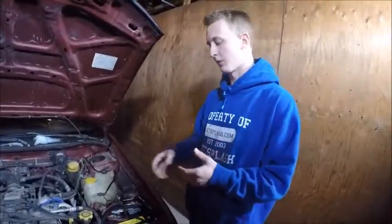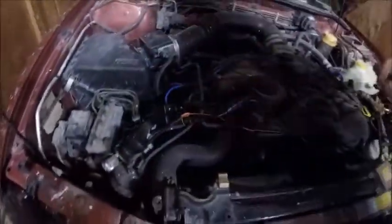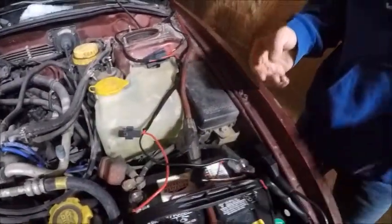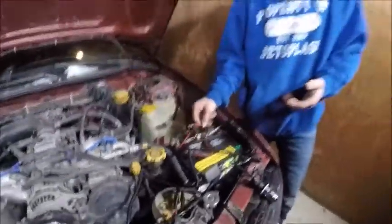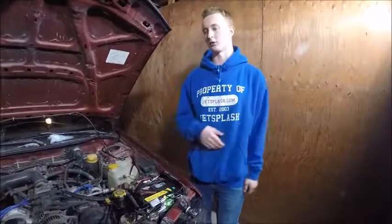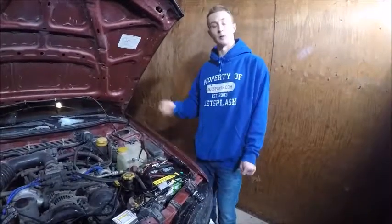This is the actual kit itself — I already put it together. It comes with the continuous wiring harness, this big long one with all the wires off it. It comes with your relays, your ballast, and your actual bulbs — obviously don't touch those. It's really simple, there's a diagram. This plugs right into your old headlight relay down there. There are two grounds off either side and a positive off the positive terminal on your battery. It comes with zip ties, screws, everything you need to mount it. Took me literally two minutes to put together.